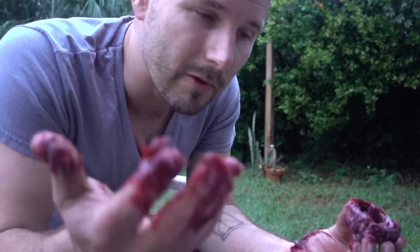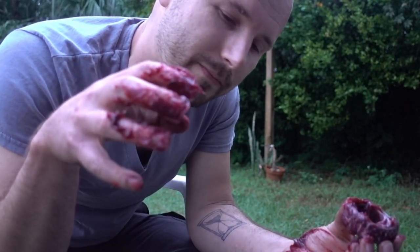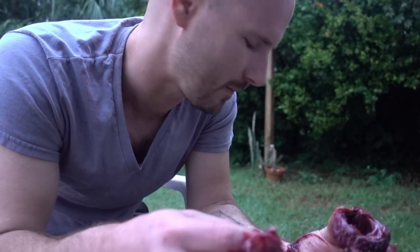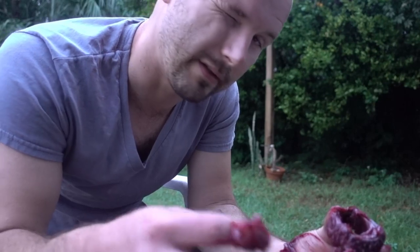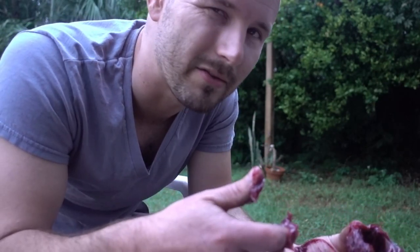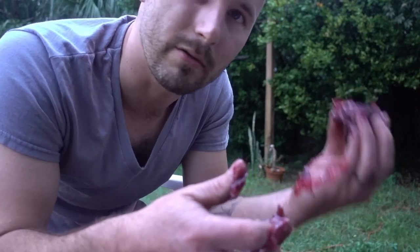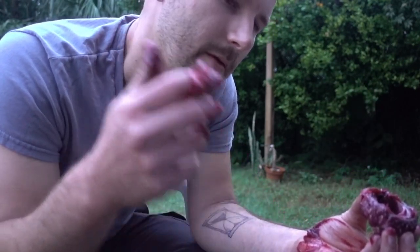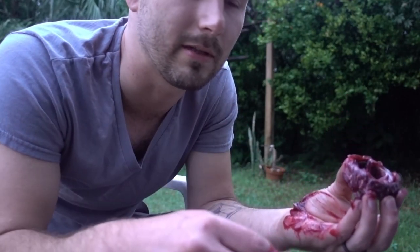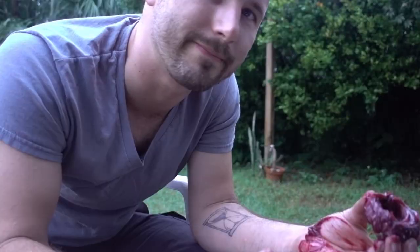And you always do the inner one first, because you gotta have that dropped in the hub, and then you put a seal on behind that. Put that seal on without the bearing inside there, you're kind of screwed. You gotta pull that seal back out. So I'm gonna go ahead and drop this in the hub, then I'll pack the other bearing, then I'll clean my hands off, then I'll put the seal in and reassemble the hub.